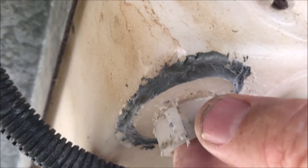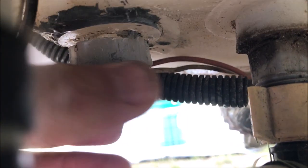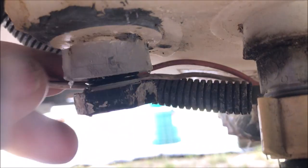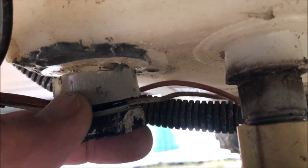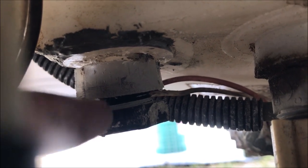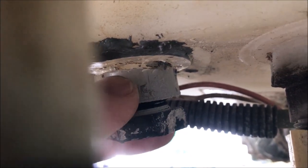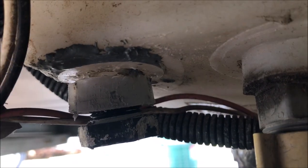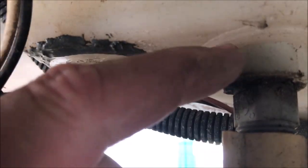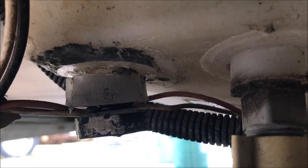As I'm putting this thing back together in preparation for gluing, I pulled the plug out and there was a whole bunch of Teflon tape on there, so I took the tape off so the threads will just go in clean. I think the way it broke is the plug is actually so long that it bottoms out against the tank body — so if someone put a wrench on it and cranked it, you'd actually pull this bung right away from the body of the tank. I put the plug in just hand tight so I have a stopper on the inside when I put the Shoe Goo on, to keep it from running inside and buggering up the threads.